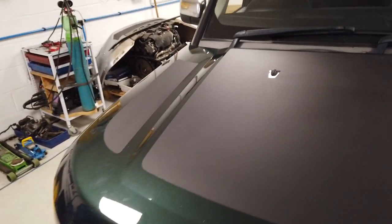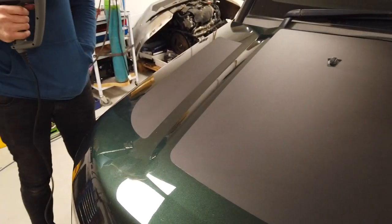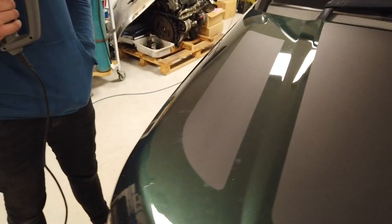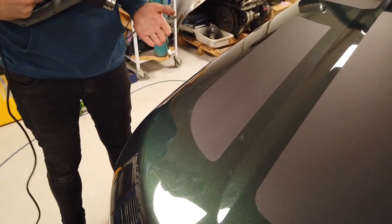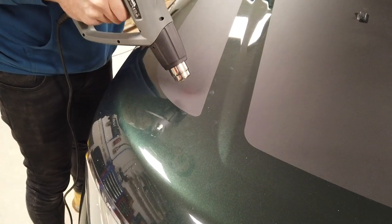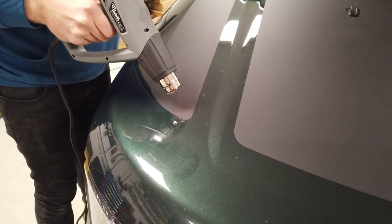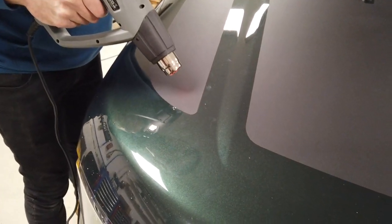I did try taking these graphics off once without a heat gun and it didn't work out well — you might notice a little scratchy part. But with a heat gun it's a lot easier. As long as you get the heat on the vinyl it's not going to mess up your paint. If your paint blisters you've done it too much. The matte black should absorb the heat.